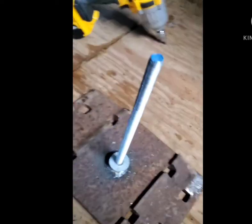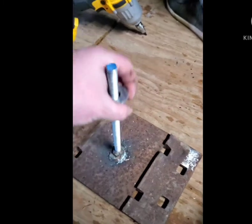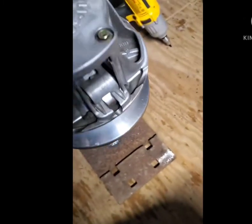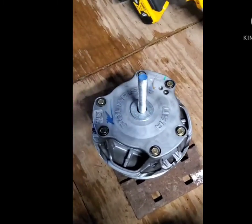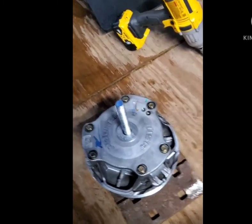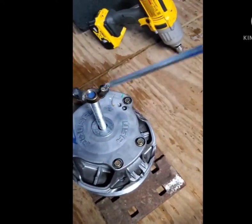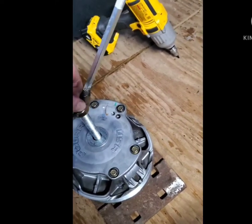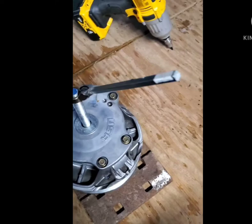I made this homemade stand just for placing your clutch on. You'll put the washer on, and then you'll grab a nut. We'll tighten this down to compress it, and then we'll pull the bolts out.